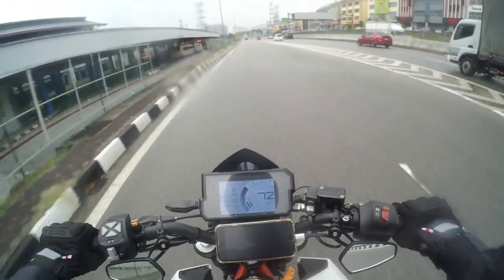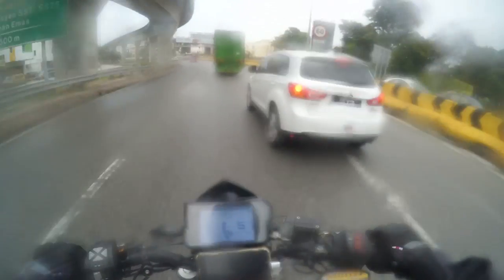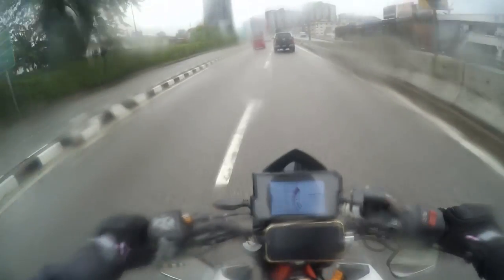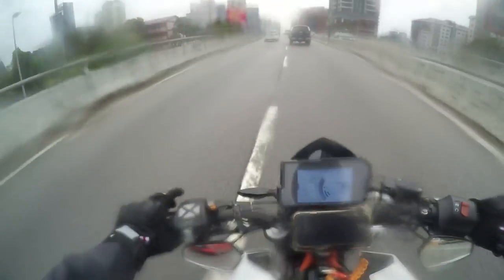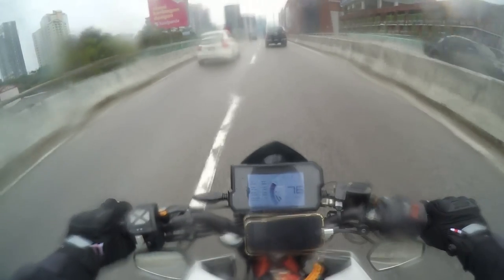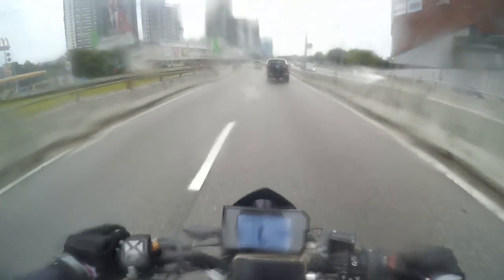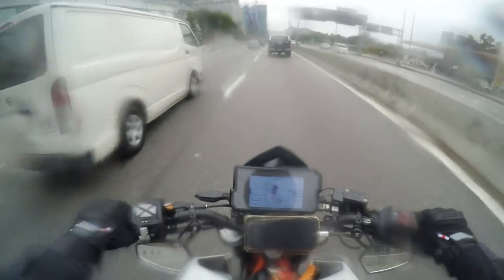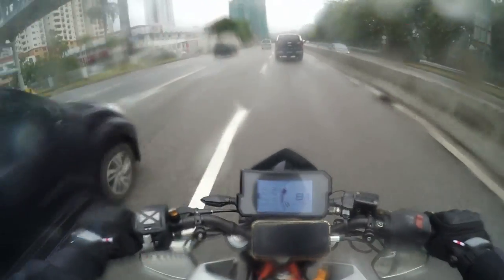Valve clearance is very important, but I'm not an expert, so here's what I do. My mechanic says every 15,000 kilometers, but I do it before 12,000 kilometers just in case. I also replace all four shims when I do it. Even if only two need replacing, I replace all four — because eventually they will all wear thin and you'd have to go back again for the other two, paying more labor fees. So when the time comes, I just replace all four together, whether they're still in spec or not. That's how I maintain my bike because I love it so much.